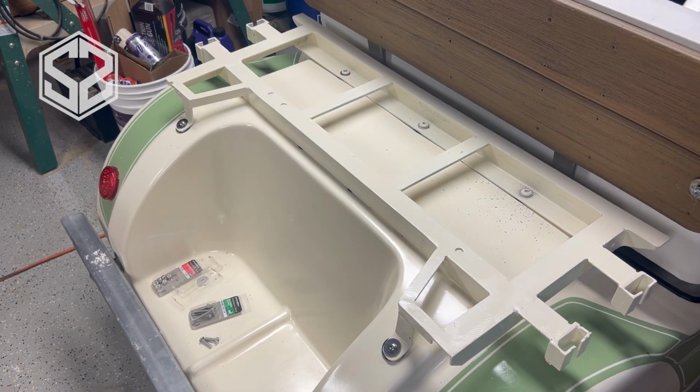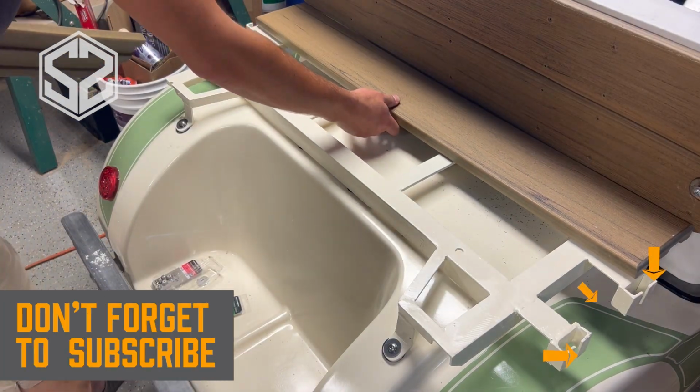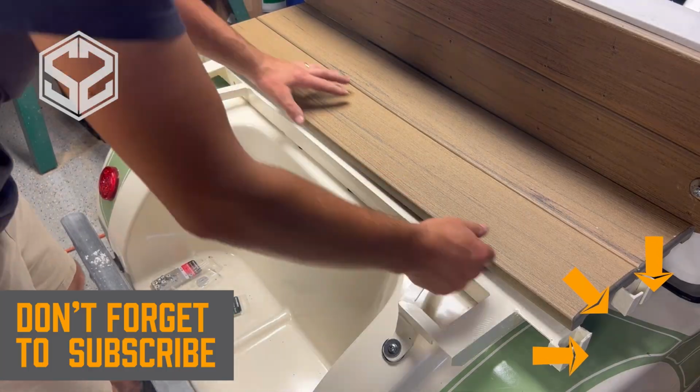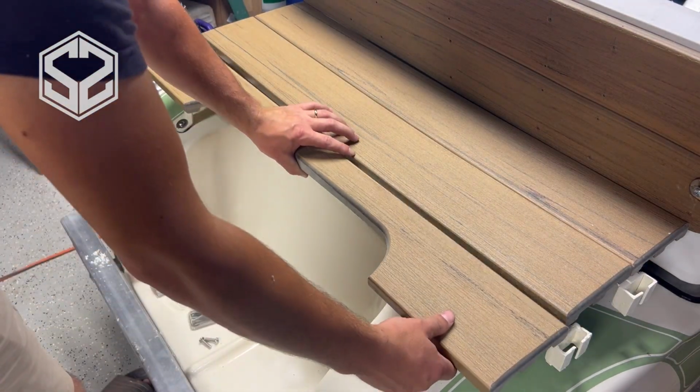Once the frame has been attached to the golf cart, I'll move on to adding the deck boards over top, and to fasten this down I'm going to be using some metal self-tapping screws. They work great for this. They'll drill through the metal themselves and then screw directly in to fasten it down.